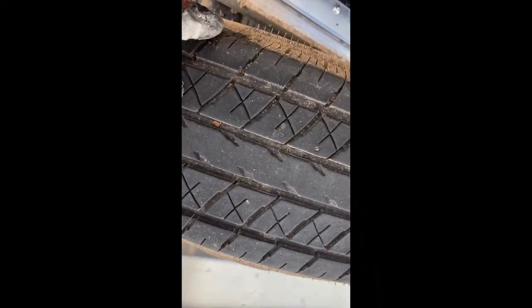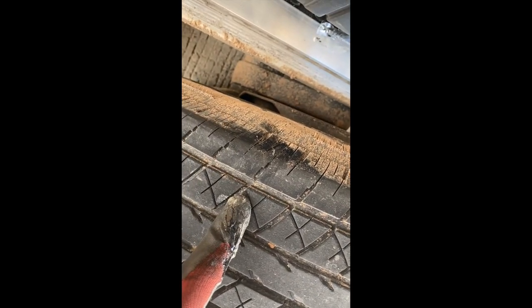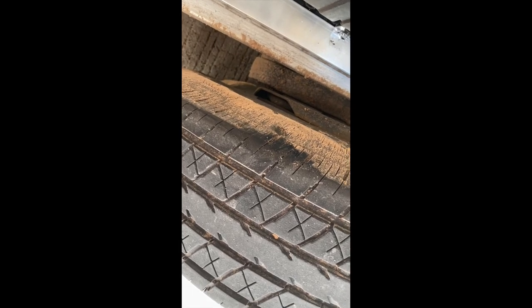Oh, yeah. Essentially, there was a big chunk of that rubber pushed out here. So that rubber plug is pushing its way out with the help of the lubrication of the Fix-a-Flat stuff. Oh, what a weird situation. The idea is I'm gonna spray it with alcohol and try to get it dry and real clean, then put in the plug. Then hopefully the next time it gets exposed to that tire sealant, it'll be firmly seated, if you will. Time will tell.